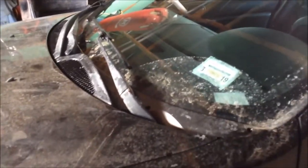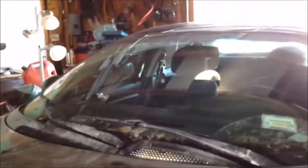Here we are — the 2004 Sebring — and we're trying to get it safety inspected. But what happens is, if the battery disconnects or goes dead, it clears the codes in the computer. For New York State emissions, it will not pick up the codes and it will not give you a safety sticker.